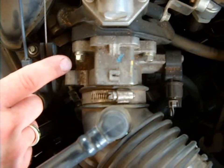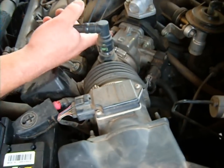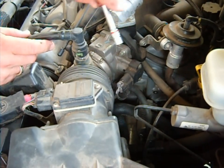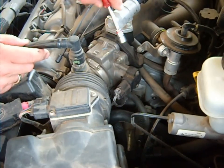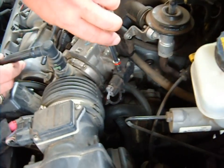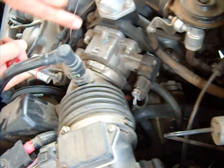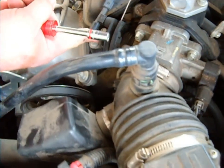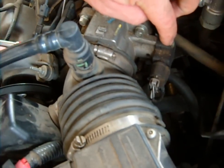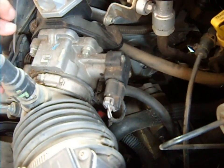The four bolts in here — there are four bolts that hold this particular throttle body on. Almost all of them have four bolts; some have three, some have five, but most have four. Over here is a sensor called the throttle position sensor, because as the cable moves and opens the throttle, there's a shaft that moves through, and this is a resistor that sends a signal to the computer to let it know how far open the throttle is.